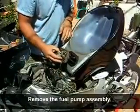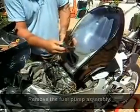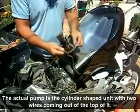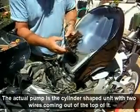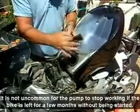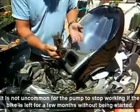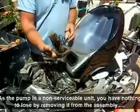And there she is. The electronic pump. It's not working. Sometimes I'm going to connect it up to the battery and just tap it with a hammer, try and get it to kick in. But if not, that's the culprit.